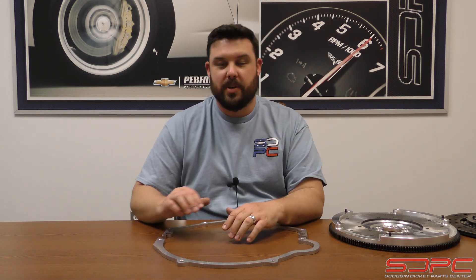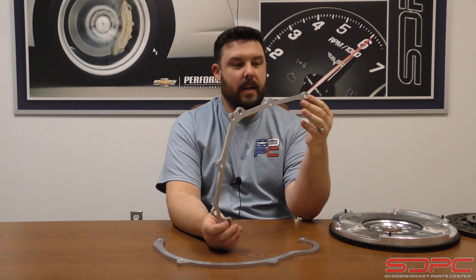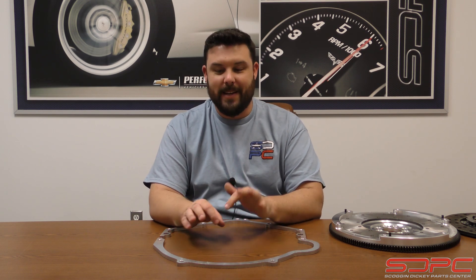So this is another big deal we need to tell you guys about. This is the solution to putting one of those transmissions behind one of those engines. This is actually right at about three-eighths of an inch thick — it's .375 inches thick — and it will give it enough space where you can still use the large pilot bearing. You will still get proper engagement on the very end of your input shaft in that pilot bearing, but it doesn't crash into the back of the crankshaft where you torque everything up and break something expensive.